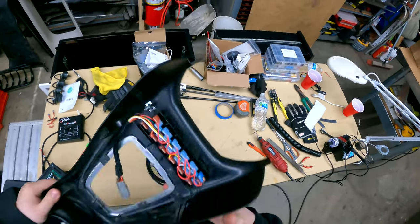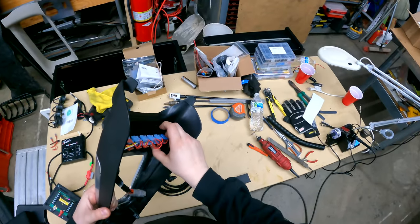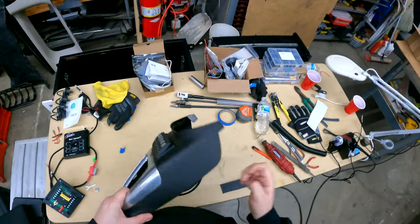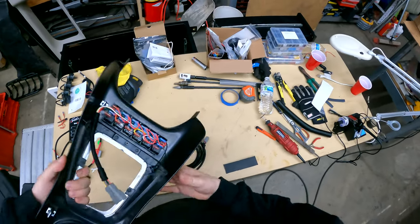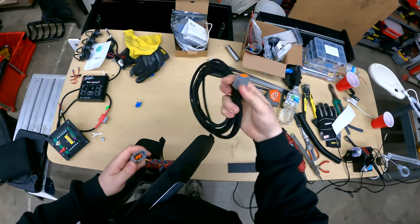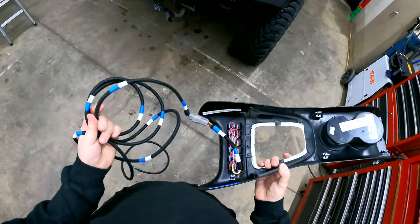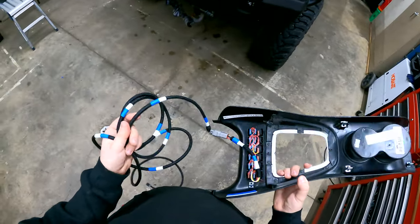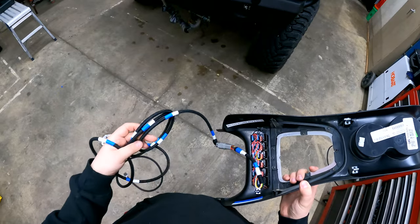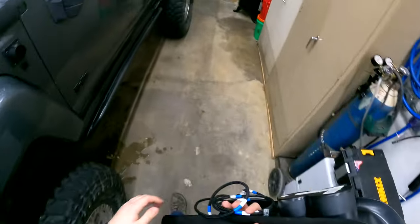I went ahead and cleaned it up — no more melted plastic back here. Unfortunately the clip right here is kind of in our way so I had to remove it to fit in our rocker switches. Now we can go ahead and try to fit in the rocker switches — and wow, first try, it looks really good, overall super clean. If you flip it around you can see the back, and you can still take it out by pressing down these tabs if you ever needed to. Now we can go ahead and connect the extension cable to it. I also went ahead and color-coded my S-Pod switch wires since I've got a number of aftermarket wires in my truck and I don't want to get them confused.